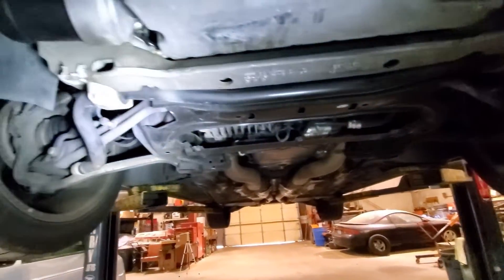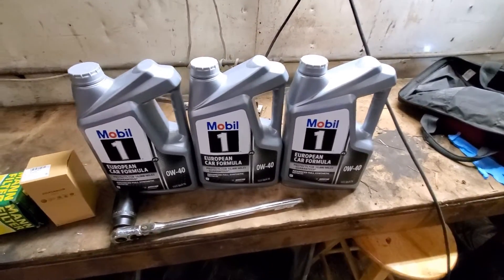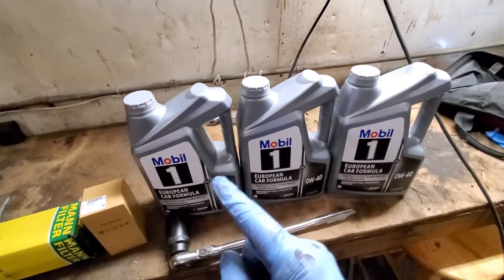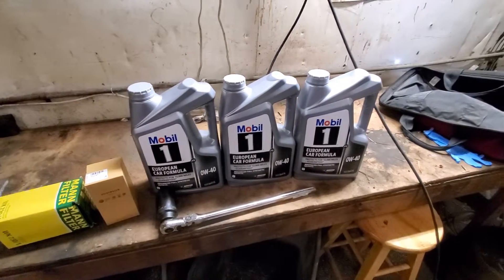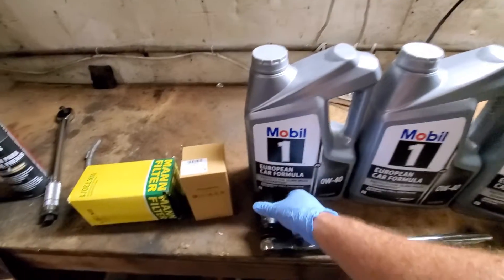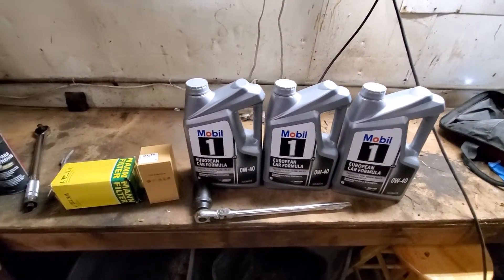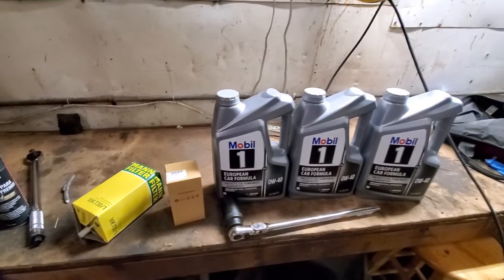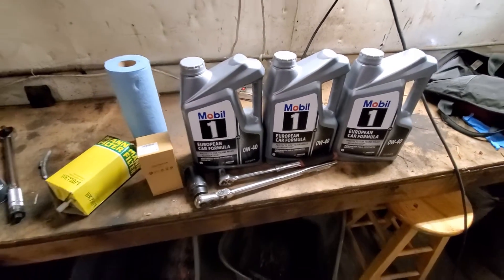Now that we have this thing up, we'll go ahead and do the oil change and change the oil filter. This car requires around 13 quarts of 0W-40 Mobil 1 synthetic. These bottles are not cheap — $45 a piece normally — but I was lucky and got these at Walmart for $23 a piece on sale. So with the filter at $18, the oil change comes in right under $100. That's a great savings, since this oil change at the Bentley dealership is probably in the $500 range. You'll also need a 36-millimeter socket to take off the oil filter housing. While we have it on the lift, we're also going to put a brand new fuel filter on and dissect the old one to check for contaminants.